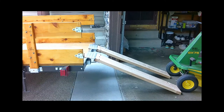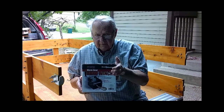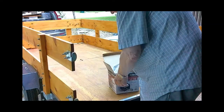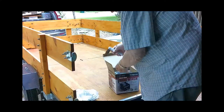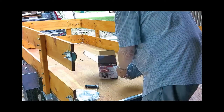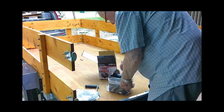I bought a winch and I'll show you what that looks like. Today I'm going to put a winch on my trailer so I don't have to drive up and down those slippery ramps. This is what I got: the Worm Gear Hand Winch, bought from Harbor Freight. It's got a dead pull of 2,000 pounds and mounts to the trailer. I'm going to unpack it now. That's the cable harness right there, the handle, and here comes the main body of the winch. This is a worm type, so the handle comes out the top and spins on a worm gear that brings the cable in.